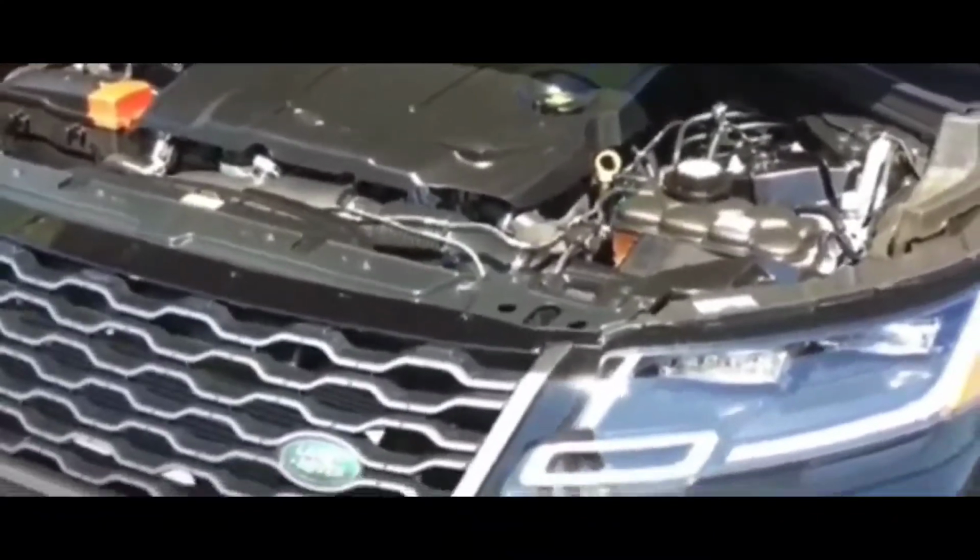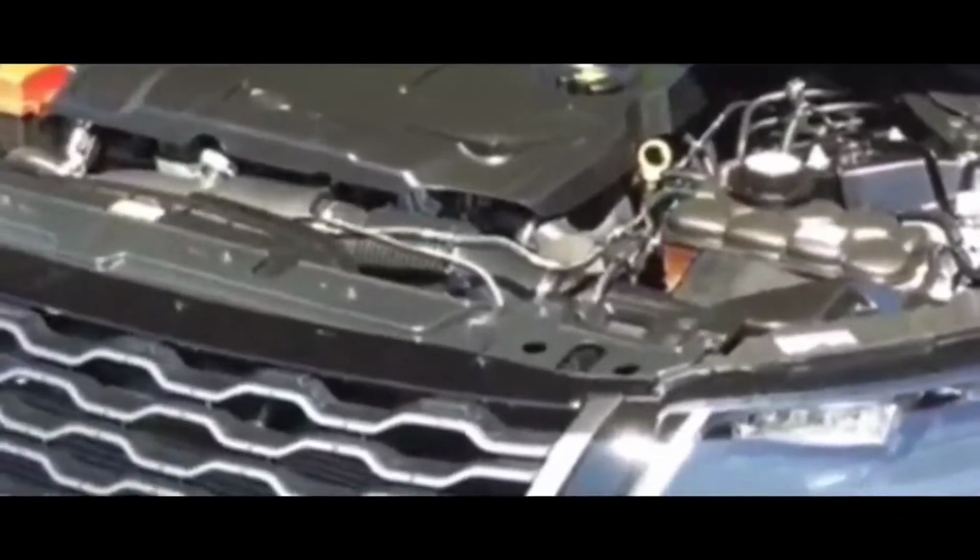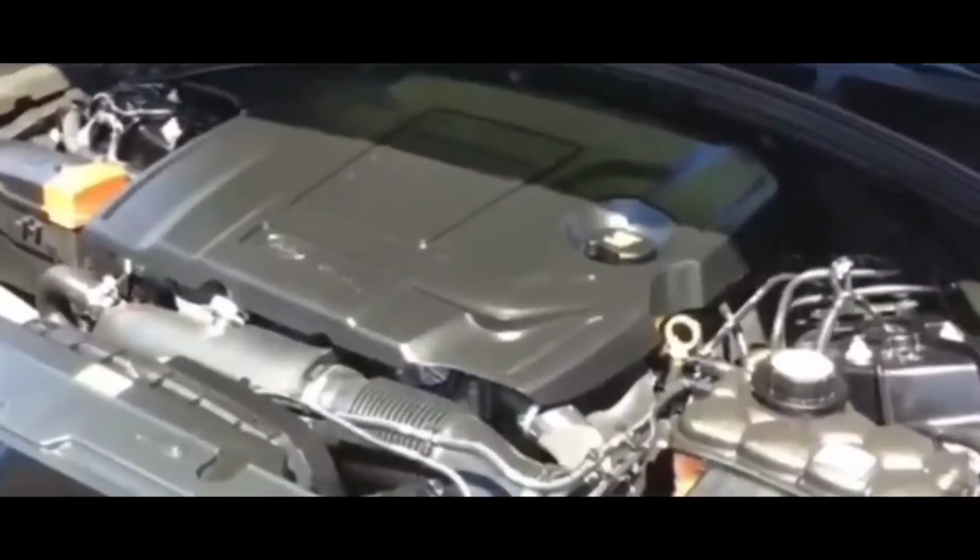I popped the hood and checked out the battery terminals, the battery, and this is pretty much probably the first thing you should do in these kinds of situations. Most of the time it's just the battery, the terminals are dirty or whatever, and I didn't do that last time because it cranked up after so many tries. Anyway, looking at the battery, I noticed that the terminals were a little bit dirty, and because they were dirty, I was like, all right, let's clean them up. And they were a bit loose too. I was able to wiggle them.